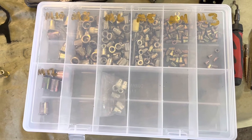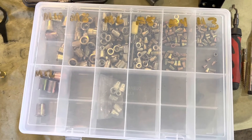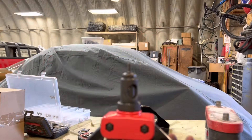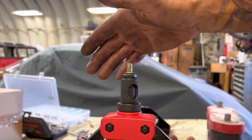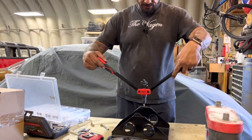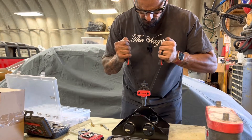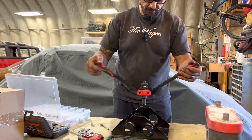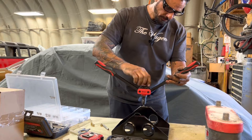I would not put an American standard thread into a VW car. So since we have all the parts here, I'll set it up so you can watch me put the nut rivets in. Put the nutsert onto the tool - it screws on easily. Insert the nutsert into your box, press down, and just squeeze them together. Once you get resistance, stop - you'll break the tool. It's done what it's doing. It's a very small nut rivet, so you don't need to go crazy on it.